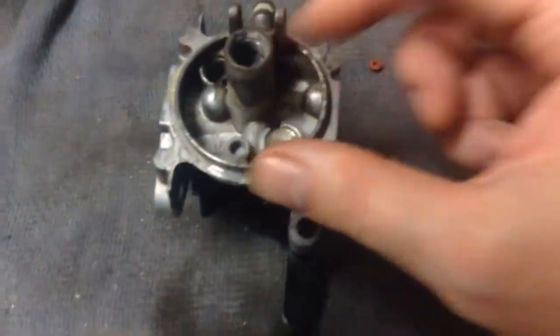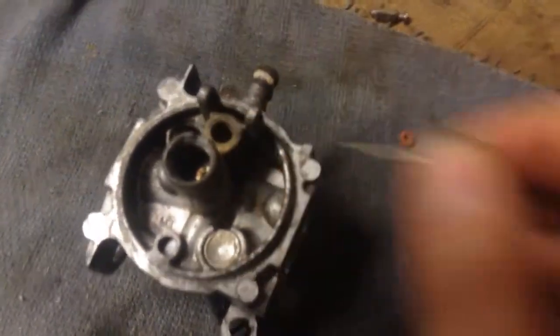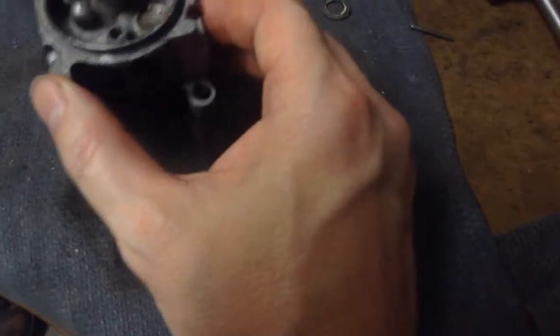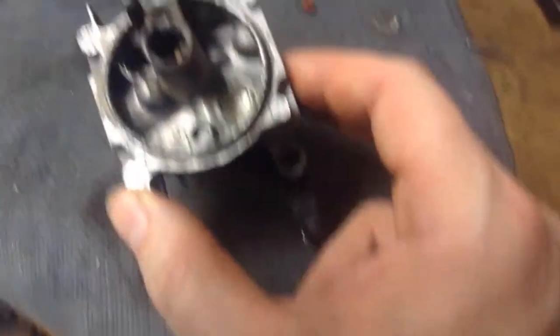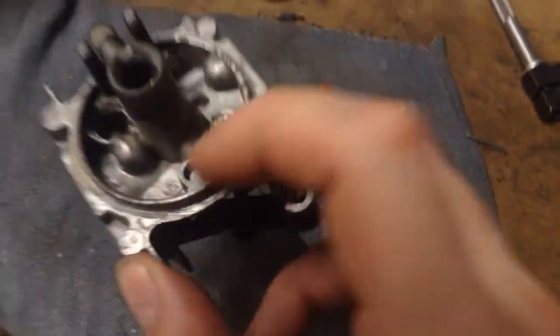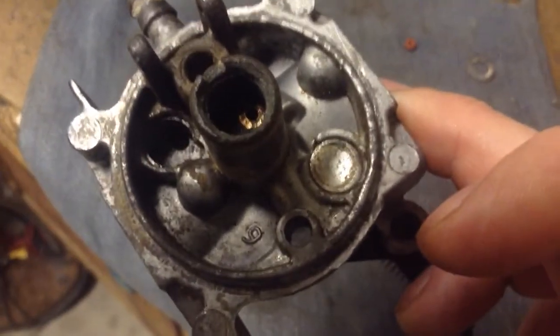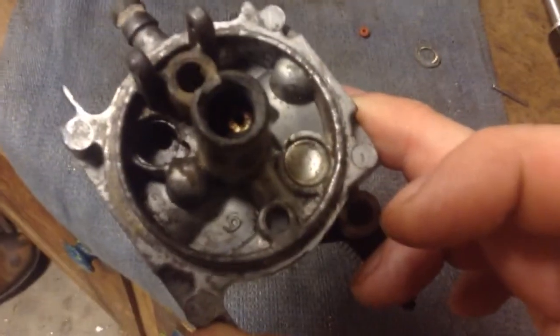This little rubber part that goes down where the needle goes — right in that hole — came out too. It's worthless. The carburetor would never run the same again. Even cleaned out, that little rubber bushing where the needle goes would probably cause it to flood all the time. And I think what you're seeing here looks like a welch plug missing — similar to what you'd see on smaller chainsaw and weed eater carburetors. But I never remember seeing it — it might be in my can of gunk.